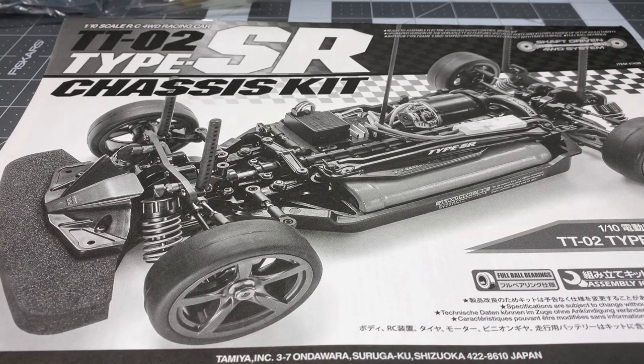This kit does come with wheels, but you need to buy your own tires. You're going to need a steering servo, ESC, electronic speed control, a motor, transmitter receiver, a battery, a charger. In my case, since I'm running a LiPo battery, I bought a LiPo alarm also. If you want to understand a little bit about the LiPo battery and the ESC, there's another video that I'm going to put a link below that you can learn a little bit more before you get started.